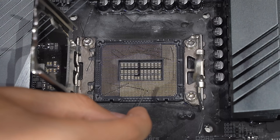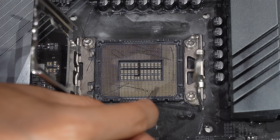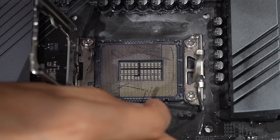Here's an example of how this could help: this one pin here is bent. I'm going to take this needle and work on pushing it down. This was totally self-inflicted, by the way, because it actually looks like the remainder of the socket is in okay shape despite being mutilated by thermal paste.